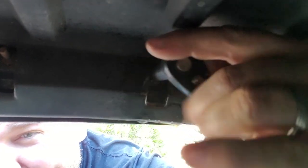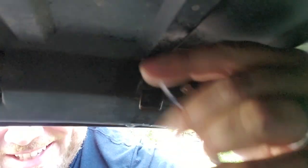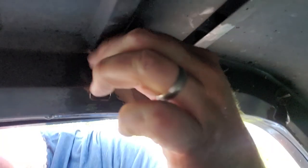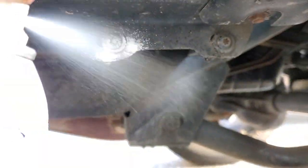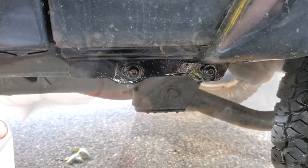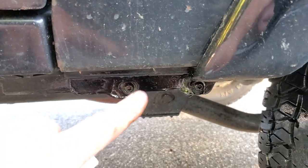Got your 10 millimeter deep dish — make sure it's on loosen. There we go. It's not broken, it's gonna be a good day. It's almost like the further it gets the harder it becomes because of all the layers of rust accumulating. There it is, it's off. So now the fender will not be attached to the body — that part's exhausting. On to the easier parts. And while we're down there, I'm going to hit these with penetrating oil — these two bottom ones have a tendency to stick.